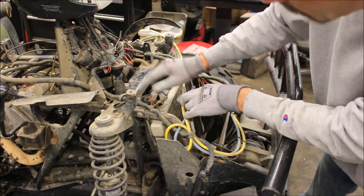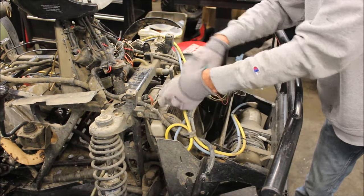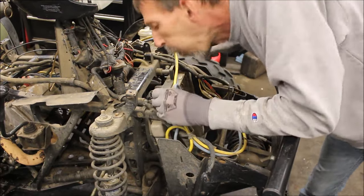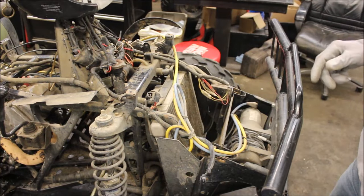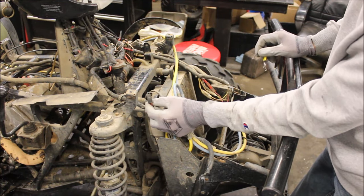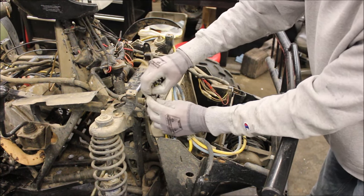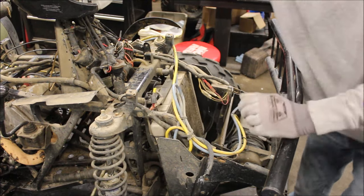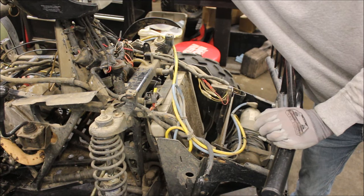Your main harness goes to your temperature sensor on the radiator, and then this other wire goes to the fan. Another thing you've got to be concerned about is they get crusty and sometimes they don't work. Now with this plug — and this is on Sportsman 400s, 500s, you can even do these on 600s and 700s — I put a jumper wire here and turn the key on. You hear that? Fan's working. Good to go.